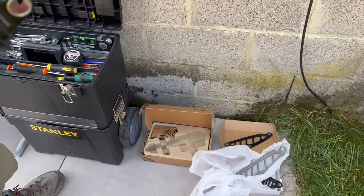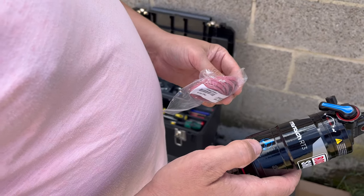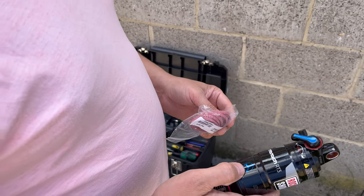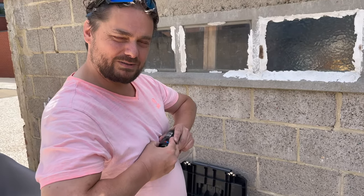Additionally, we're going to upgrade it from the start with bottomless tokens. That increases and improves the shock — at the end of the travel you have more progressivity, so we're not going to bottom out that way.